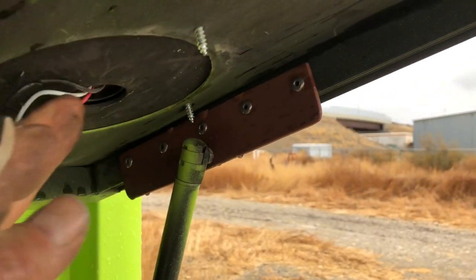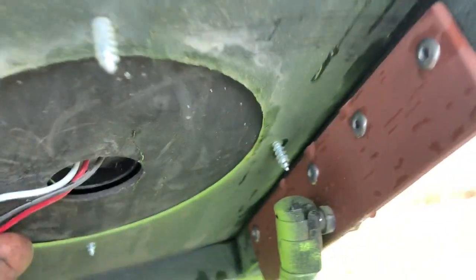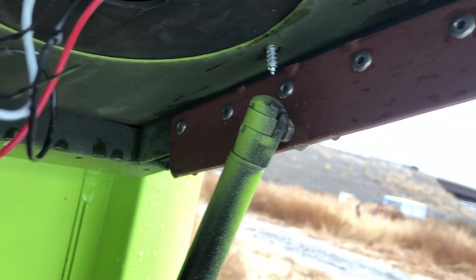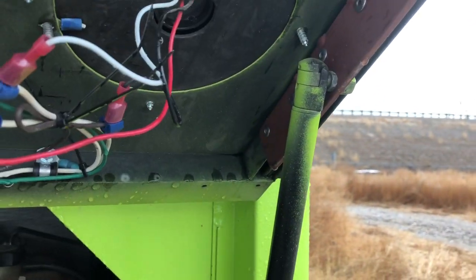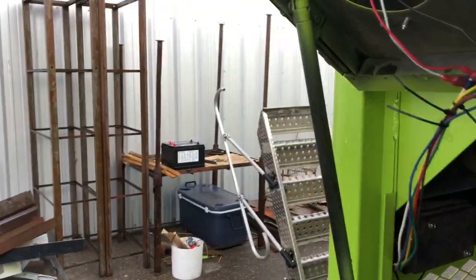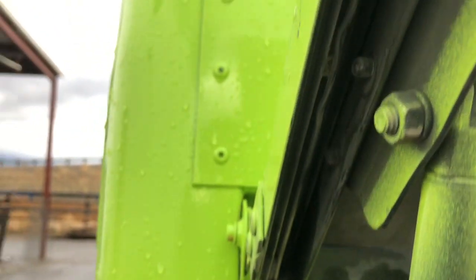I got that job pretty well cleaned up. For the new plate, if I put it on like this I could make it thicker and put a couple more rivets in it — and these are stainless rivets versus the aluminum rivets it had before. So now it's got stainless rivets, a couple of extra ones, and heavier metal where it got all walled out. That's a done deal. The hatch cover doesn't stay up, so I ordered two new gas struts, but those are easy to put on — no big deal. Now I just gotta do the same thing over here on this side; this one's loose and bent and starting to wall out too.